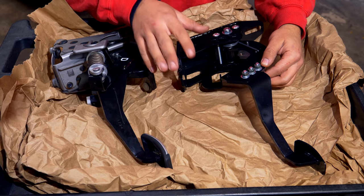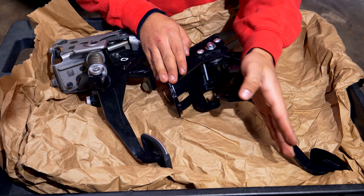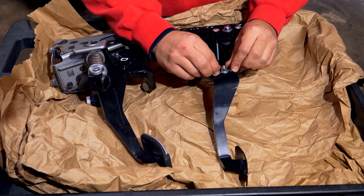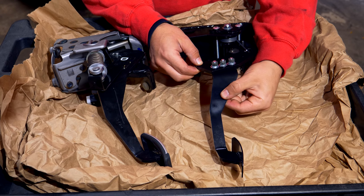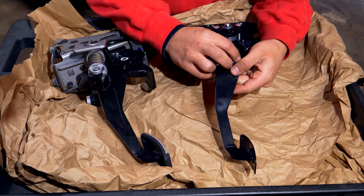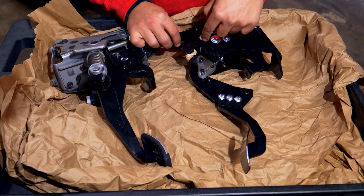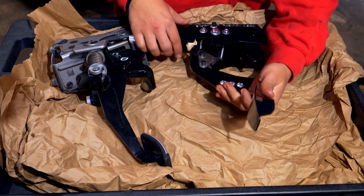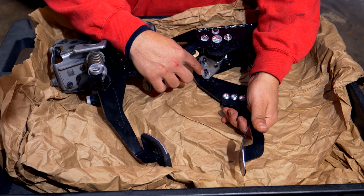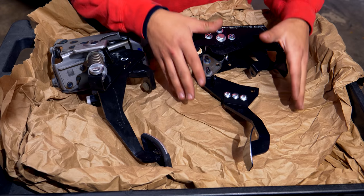Before we install, let me show you some really cool things about this clutch setup. This pedal is completely adjustable — you can change the angle of it in relation to the entire mechanism by loosening all three nuts. You can adjust it to any angle you want, then tighten up the nuts to secure everything. What's cool too is that if you flip it around, you can also adjust the fulcrum point — where the entire assembly sits in relation to the pivot point — by loosening and tightening bolts along the sliders. I'm going to leave it as-is and install it on the car, doing further adjustments afterwards.